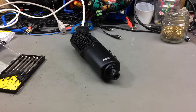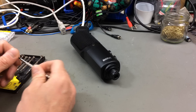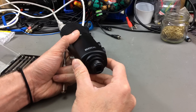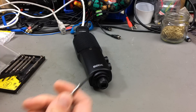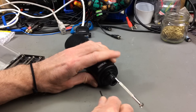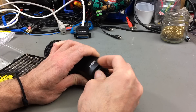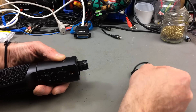I hope I can get this fixed easily. If you've been following my channel, you probably know I used to work as an audio engineer and dealt with quite a few microphones. Usually they're shaped like a pipe and screwed together — and in this case, this is also screwed. There's a ring that comes off, you can see it's screwed on with little holes. There are probably proper tools for this, but I'm just using two screwdrivers on opposite ends to turn it. This works pretty well even when it's tightly screwed on. There's a little plastic seal that sits in there.